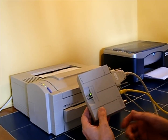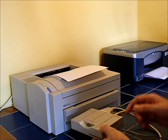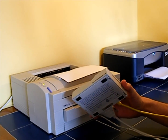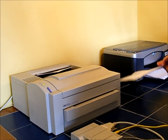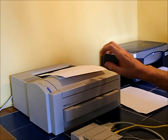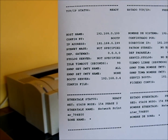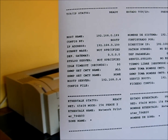I've just pressed the test button again on the print server as I did before. Since we've set up the BootP server to accept the BootP request from this device, it has now been assigned the IP address 192.168.0.199. The second sheet that comes out is the one that has the IP address on it, and hopefully we should see that it reads 192.168.0.199 — and if it does, that is job done as far as the print server is concerned. It does indeed now say an IP address of 192.168.0.199, config by BootP. And that's basically now set up to allow us to talk to the printer.